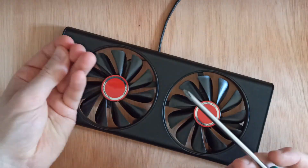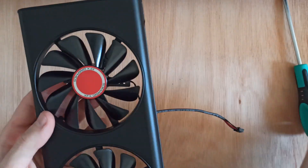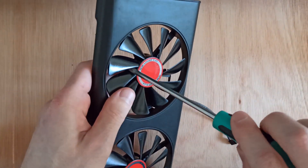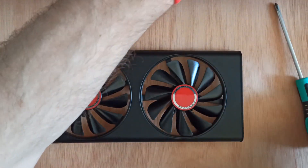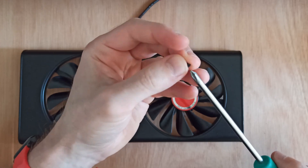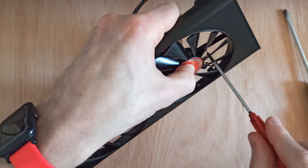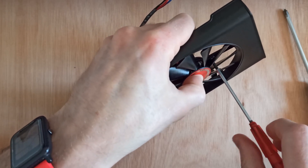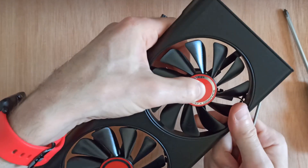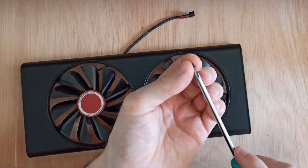The rearmost fan, near the fan wiring connector, can be secured. There's no other orientation for it that could compensate for the drastically shorter cable of the new fan. The next fan is under pressure from the already clipped-in wiring. I'm going to see if I can get one screw in, and then it will just need some simple rotation to fit the other two.